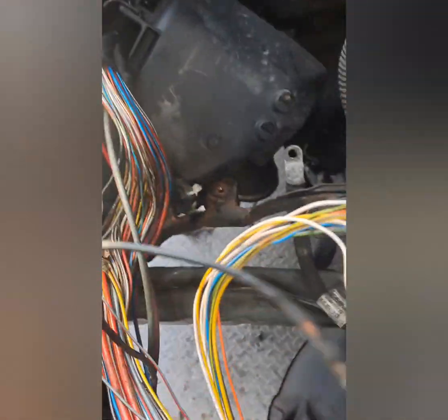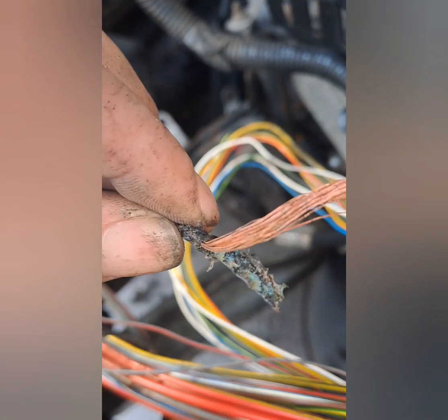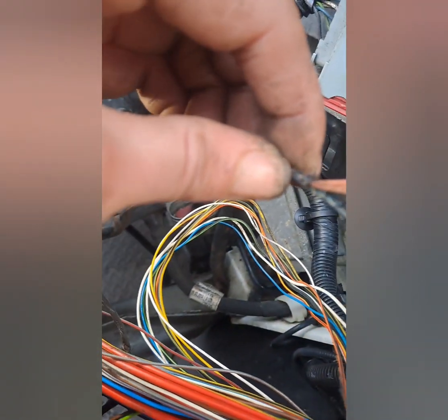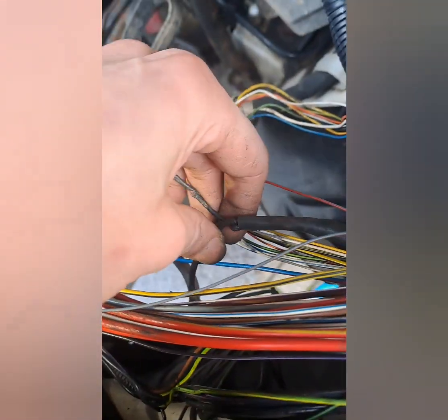It wasn't running up here — it's just another cable that joins up, runs down back behind, down underneath, back up into the battery box. The earth wire is completely burned. What we've found is this connector here is burned as well. You can see green, crispy bits there — I'd almost say that looks like corrosion along the wire.